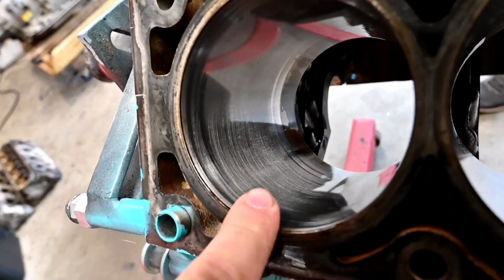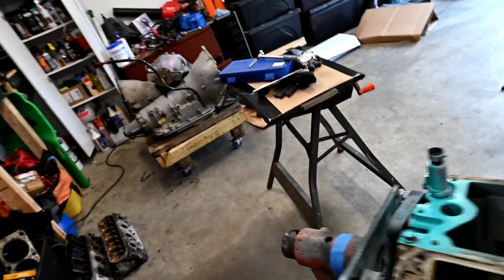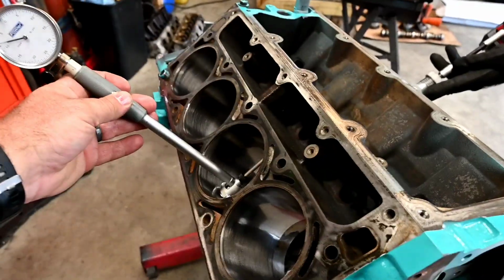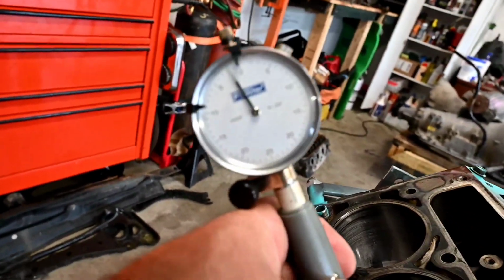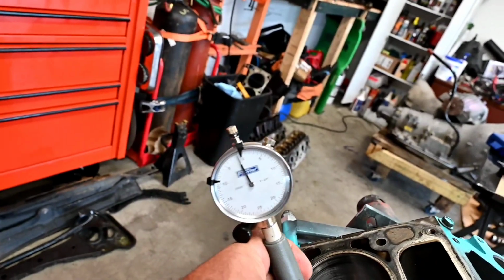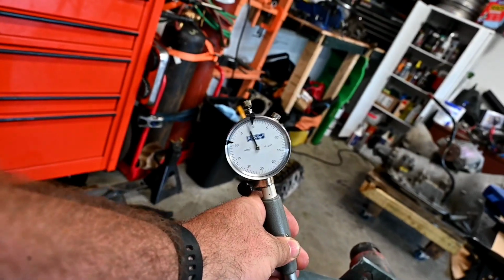You can see that the cross hatching is working really, really well. I've been measuring, making sure we haven't been removing any material, and we haven't. And for the engine, as old as it is, and how it's doing, we've only lost some. It's set up for 4 inches because it's a 4-inch bore, and I don't think that is too bad for 500,000 miles. I mean, they're all in really good shape. So this one's in exceptionally good shape for 500,000 miles.